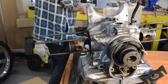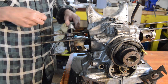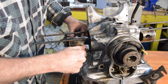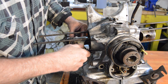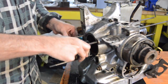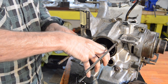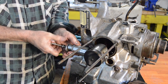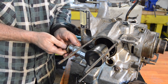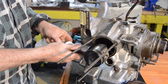Let me just find my bar. Right, different bar from last time just for the fun of it - slightly stronger than the old one. That will act on the gudgeon pin which will pull through into the hole created by the large socket. Let me just tighten that up, and of course this will impart no sideways movement on the crank at all, which is what we want.